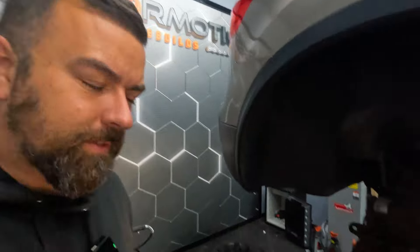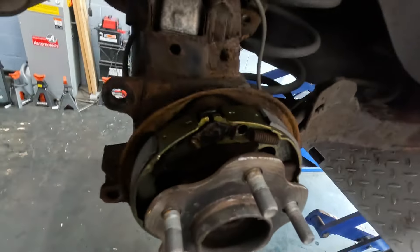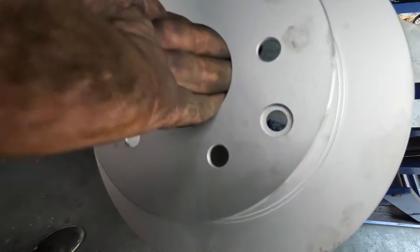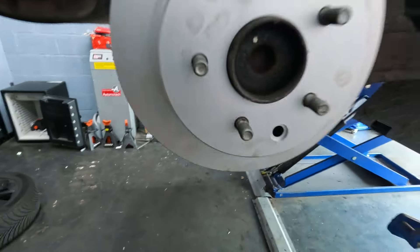While I was doing that the camera turned itself off — brilliant. I struggled getting all the springs and stuff on, so I'll show you on the other side. It was a struggle — you always have a fight with new shoes. Now the new disc is going to go on. I'll line up that hole in the disc with the adjuster, then I can wind it out until it stops the disc and back it off a little bit — that's what I tend to do.